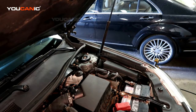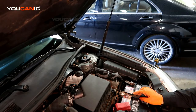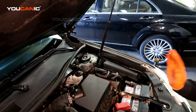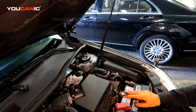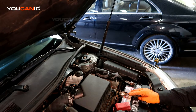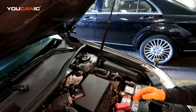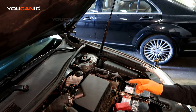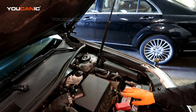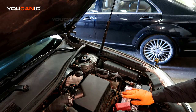Welcome. In this video we're going to show you how to do the brake fluid bleed on a vehicle. This can be helpful if you feel like the brake pedal is very soft when you press it and spongy — that's an indication that you might have air in the brake lines. Also if you replace a brake hose, you're going to have air in that section. And if you're looking to flush the whole system, you can use this method.